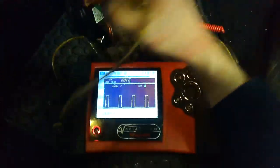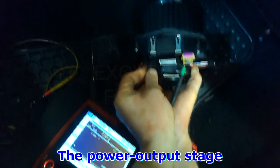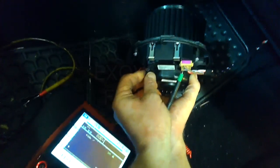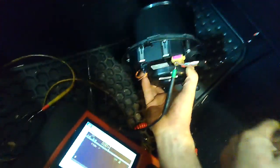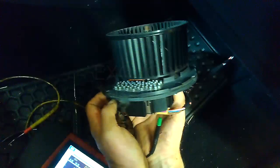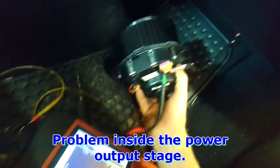So we know the switch is good, control is good, but the computer doesn't like something with this motor. I plug it in, it's going to go on, but it'll shut off — it just shut off. It doesn't like something internally. It could very well be that this power output stage it doesn't like. But we're going to put in a motor at this point.